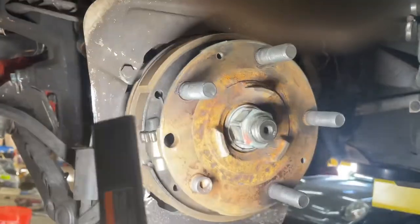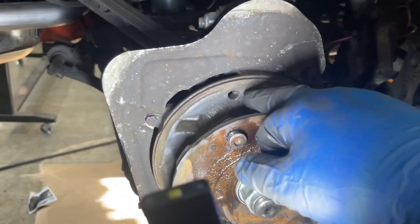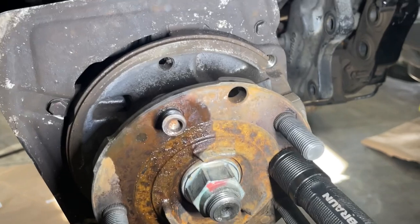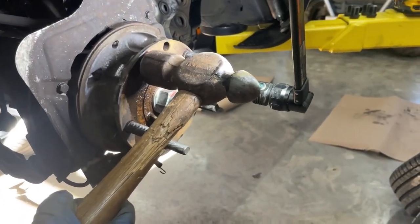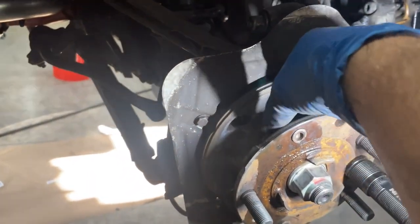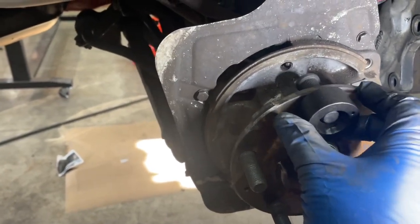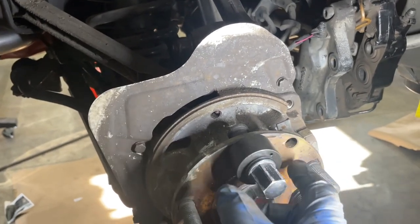I undid the compression spring on the top for the brake shoe. I only took one shoe off because I only have one wheel stud to replace. I gave it a little bit of penetrating oil and let it sit about two minutes — it's actually pretty easy, it's just pressed in there. It comes out pretty easy with a couple of small whacks. Once you get that wheel stud in, I've got a wheel stud installation tool. Push the two together, thread one of my lug nuts on, and then use the impact wrench to draw it tight. That worked very well — it pulled that wheel stud right in place.